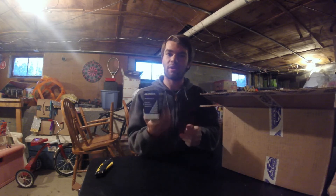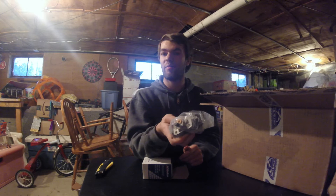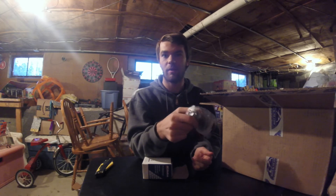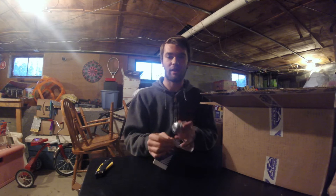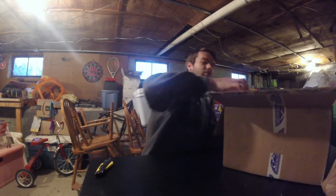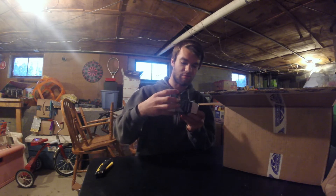This might be a wheel cylinder for the drums — yeah, hydraulic cylinder for the drums. One bleeder is locked up and another snapped off. The rear end looks like it's got a lot of miles on it and was neglected — the shoes were down to the metal. So all new brake hardware all the way around. There's one cylinder, and there are two in here of course. Using good old GM parts for my Chrysler product — yeah, that's the other cylinder.